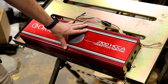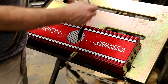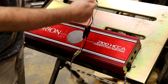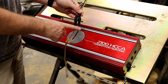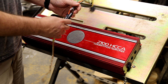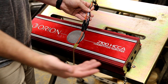On this one we get to look at how things were done way back when, starting with the plug. This is a 2-channel amp, so this is one set of outputs and this is the other set — one channel and the other channel. Orange stripe on black, yellow stripe on black, yellow, orange. So naturally this is bridged. Our remote wire comes off of that, and yes, these are fuses — the outputs were fused, which is actually kind of a good thing. It helps prevent the amp from blowing up when you go over current. If you wired it too low or maybe the protection isn't so hot, the fuses would pop. Or if you blew a sub and it went to dead short, fuses would pop instead of popping the amplifier. So it's actually not a bad idea, though it's not something that's been done in a very long time.